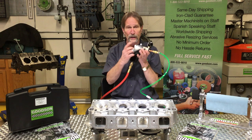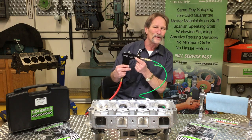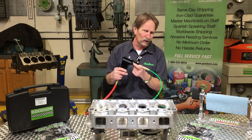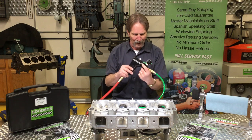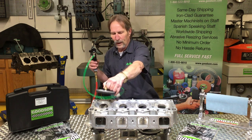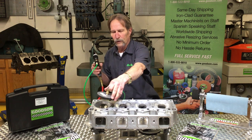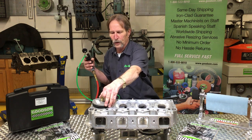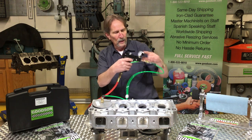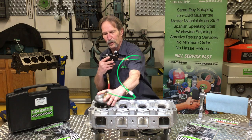One other thing I want to let you know — we create so much vacuum with this unit that we have to incorporate a vacuum release valve. I know it's not the most clever industrial term, but that's what this is, a vacuum release valve right here. So when you're done, you don't have to try to wiggle this thing off the workpiece. Just press that, release the vacuum, and right down the boulevard you go. With this hose kit on, it makes it real simple. I can keep the gun in my hand, pull the vacuum, read it right here on the dial, hit my release, and I'm quickly off of that.